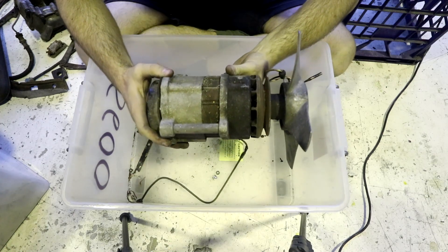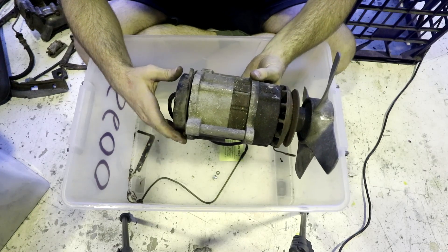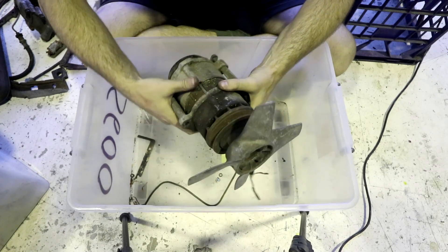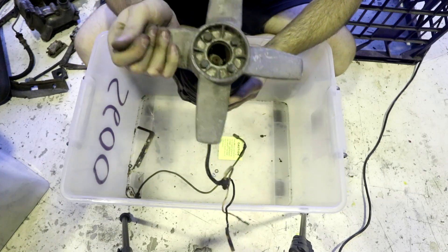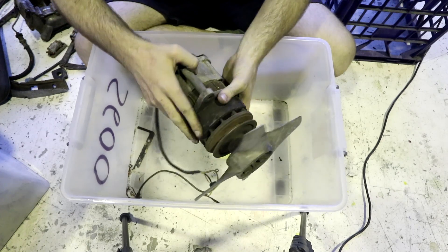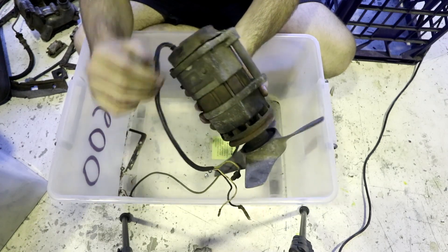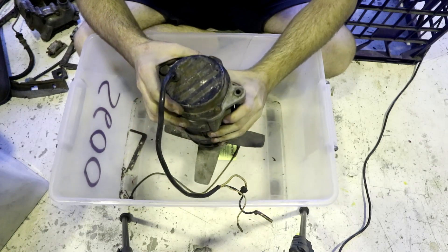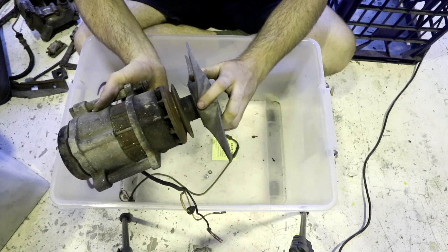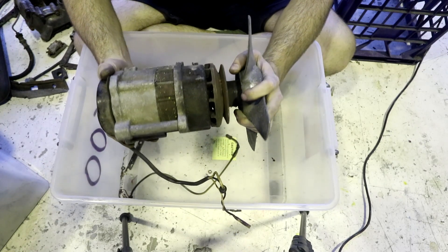And the last thing — this is the generator. A modern car has an alternator, and it's called an alternator because it puts out alternating current. I'm pretty sure this is a generator, so it puts out DC current. It'll have to be regulated down to 12 volts. It's not happy — that's not good. So this will be interesting to fix up — this is definitely going to be one that might be getting fixed up sooner rather than later. It's got a cooling fan on the front for itself, and then a V-belt to drive it. It's got a cool little grated cover on the back. You can see it's a lot simpler than an alternator. This will be getting fixed up soon because it's obviously got a seized bearing or a ruined winding or something in it. And I've got another aluminium radiator fan. I'll mark this down as generator, and I'll write down the fan separately.